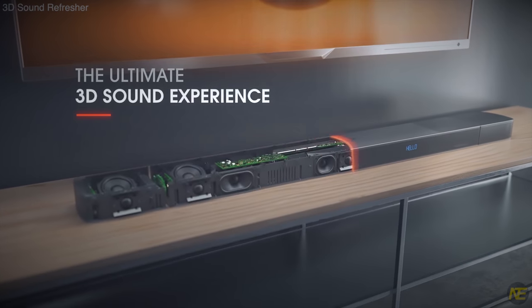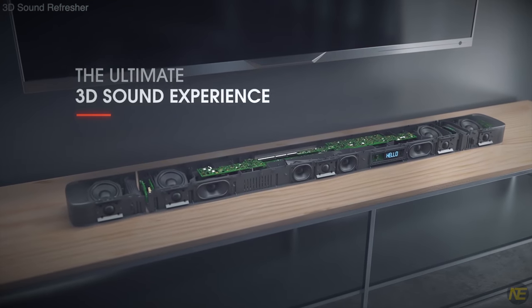So anyway, 3D sound has been around for a while, but has typically only really been attempted with a traditional home theater setup, with big speakers hanging from the ceiling, etc. Soundbars, which are much easier to set up than a traditional home theater system, are now trying to deliver 3D sound as well, enabled by higher-end processing power and upward-firing speakers that are meant to bounce sound from the ceiling, mimicking ceiling-mounted speakers. If you want to know the number of upward-firing speakers a soundbar has, look at the last number here.